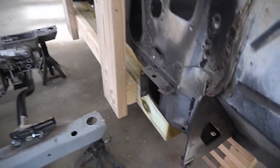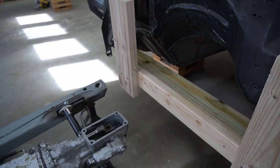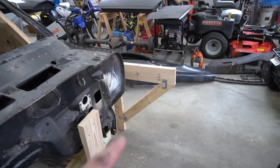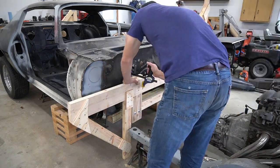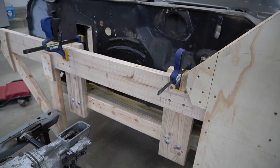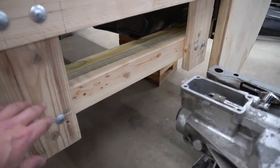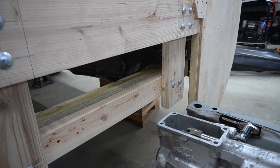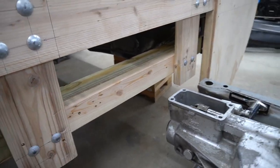The spacer is in there — just held with screws right now. We're going to drill through the rest of the way and put the 8-inch bolts in place. Bolts are tight. Moving this piece over, getting it lined up and drilling through, putting the bolts in. The piece is clamped in — going to do the bottom two holes first, remove the clamps, then do the other two. It's all put together, but I'm going to make an L out of some scrap 2x4 to build this up a little more — it's a little too flexible for my liking. Screwing two pieces together will let me attach more to this plus the verticals.